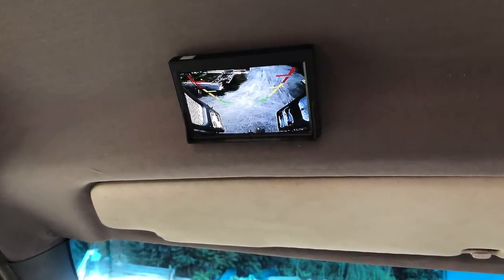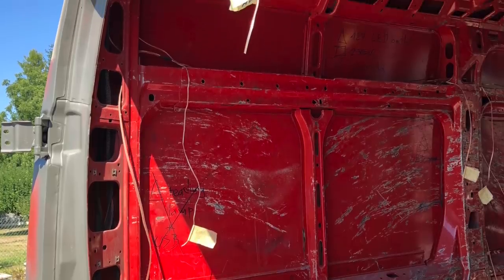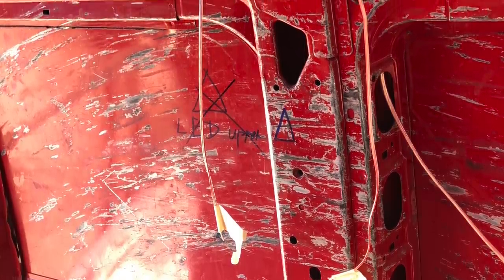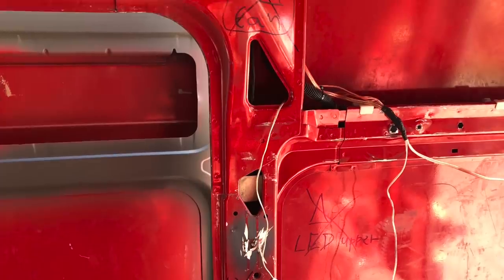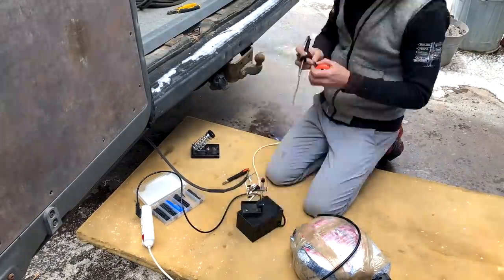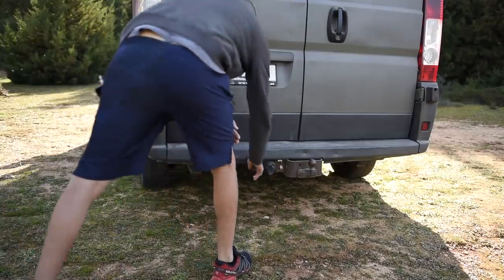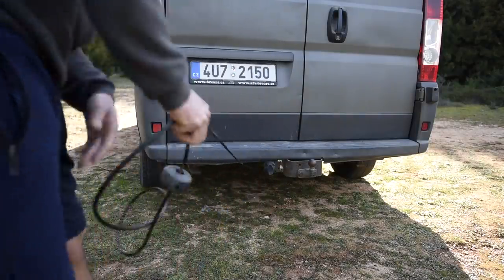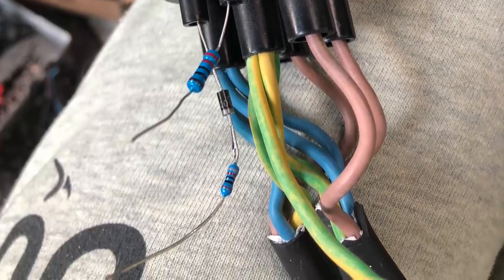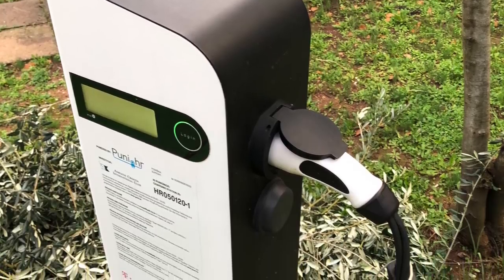In the following steps you can do wires or insulation, whatever you prefer. I decided to do wires first. All wires should be in protective hoses so you don't accidentally cut through them — I learned this the hard way, so please avoid it. Plan it with a marker. Plan your lights and switches, reversing camera, inverter, water pump, fan, and everything else. I also added an extension cable drum from the bottom of the van — very convenient to just pull the cable out. Make sure you have plenty of USBs everywhere. I also made a car charging reduction cable for charging stations so I can plug the entire car in and use power inside, charge e-bikes, etc.